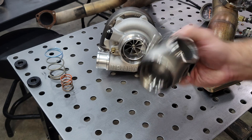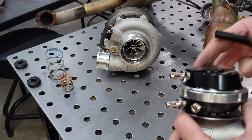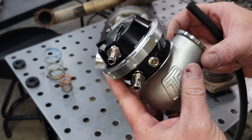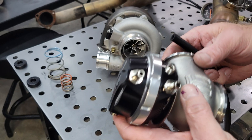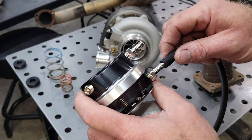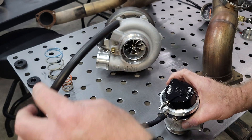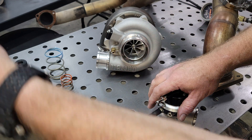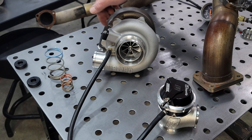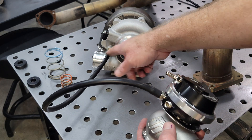I'm putting this on my car for the first time. I want to go for a test drive — I do not want to send it to the moon. I've got all these fancy boost controllers with solenoids and dump valves and CO2 tanks and electronic doodads. No — just disregard all of that for right now. Very simply, bottom port of the gate, exactly where we tested the pressure. Just take this and go direct to your compressor cover boost reference port. It may be in various locations, but super simple — direct connection from here to here.